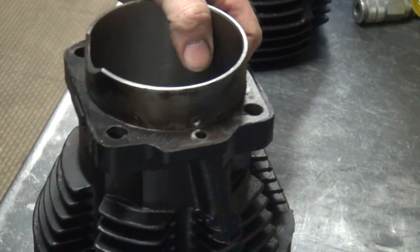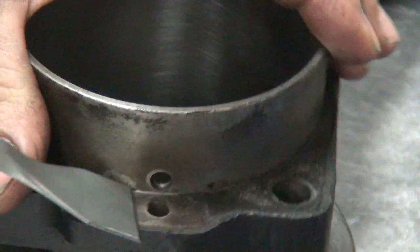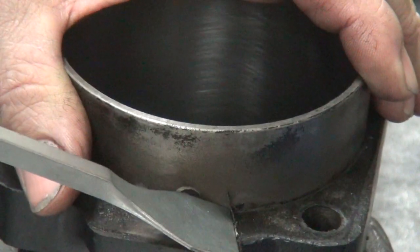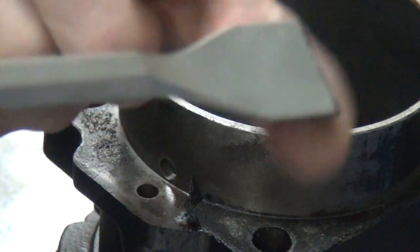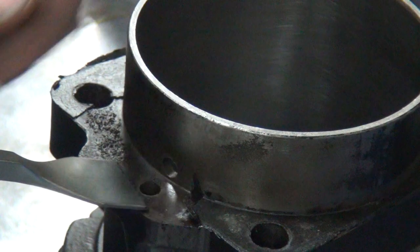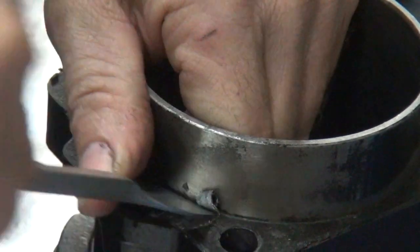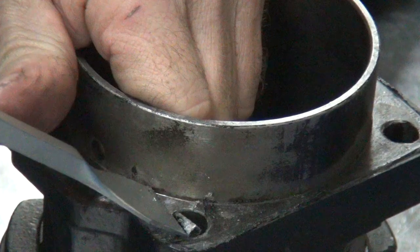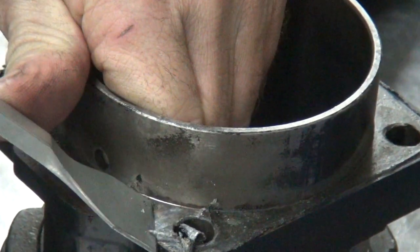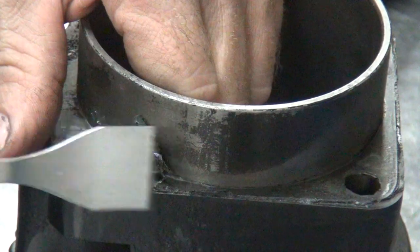You can see how there's a little bit of gasket remaining right here. So I just come in like this to do that hard edge — you want to make sure you try to cut the whole gasket off. I just pivot with my thumb right here and push with one corner, pushing down hard on the contact point. You take off a little piece at a time. Now, if you use those grinding flap wheels, all they do is tear up the surfaces and make them very unflat — they'll leak like a sieve. Plus all that grinding grit has to get out of your motor, and it'll destroy your new motor.